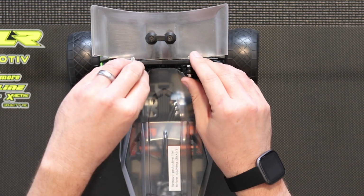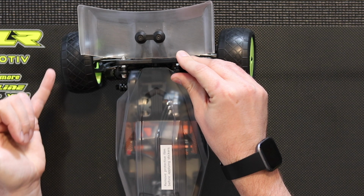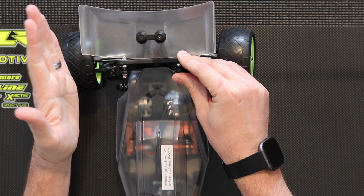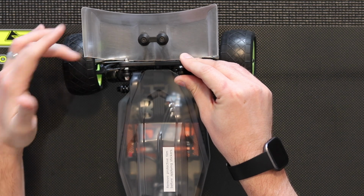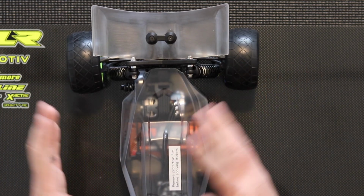because that would keep the tire straight up and down and keep the whole width of the tire on the ground. When the car rolls though, you can see where we've rolled far enough that the tire is actually leaning out and the inside of the tire is having weight come off of it. So it's kind of a balance between the two of how much tire contact you have when the car's flat and how much when it rolls.